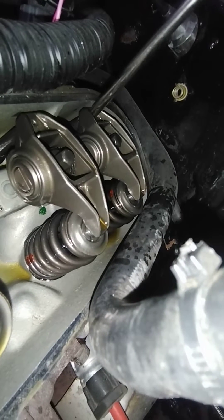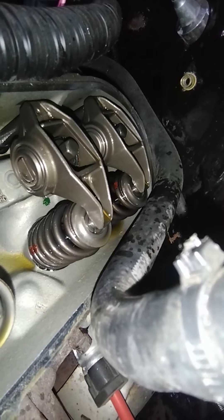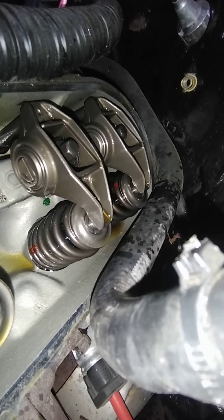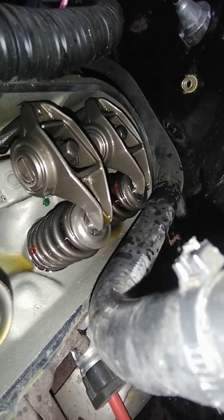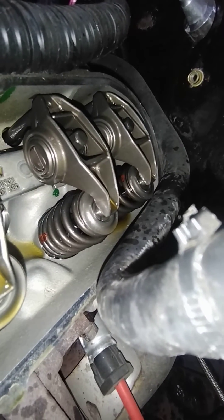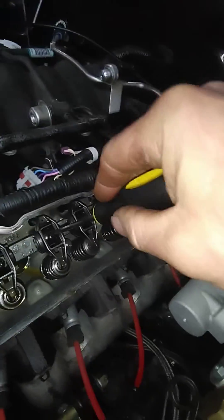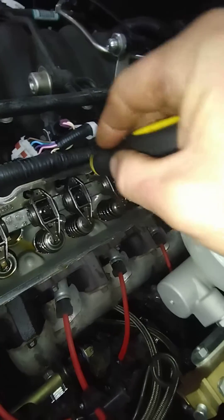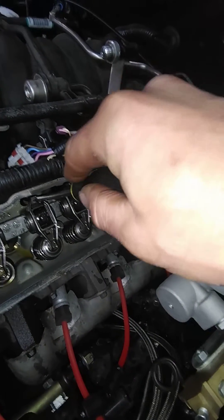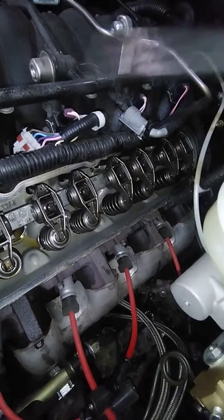See that? No matter how I rotate the engine, if the piston's all the way up to where the valves are both closed and there's no pressure on it, those are loose like that. But like these two right here, they're all the way up and they're firm — they don't move at all. That's because the lifters are pumped up full of oil.